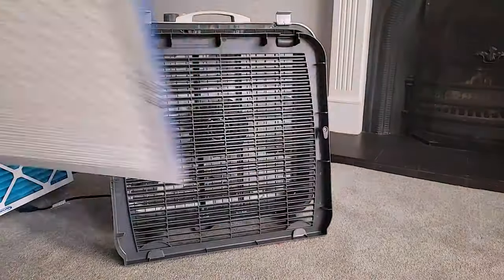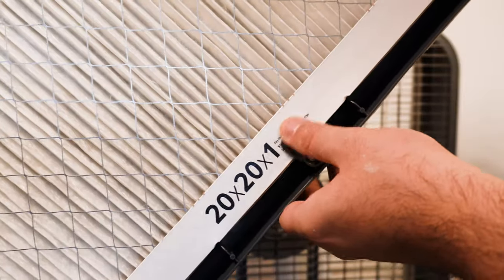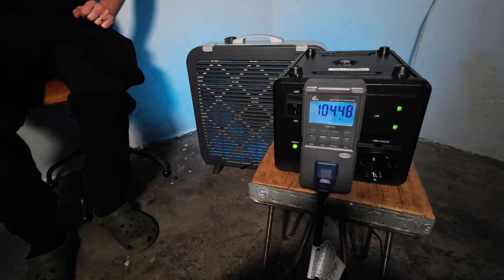The first thing I like is it had great air cleaning performance when we swapped out the filters for the 3M Filtrete 1900. It was also much easier to use than any DIY device. You can use any HVAC filter measuring 20 by 20 by 1 inch, and you still have the functionality of a box fan by just removing the filter. The three things I don't like: it's loud especially at top speed, uses a lot of energy compared to other HEPA retail devices, and even at speed one it was still too loud for a classroom or office environment.